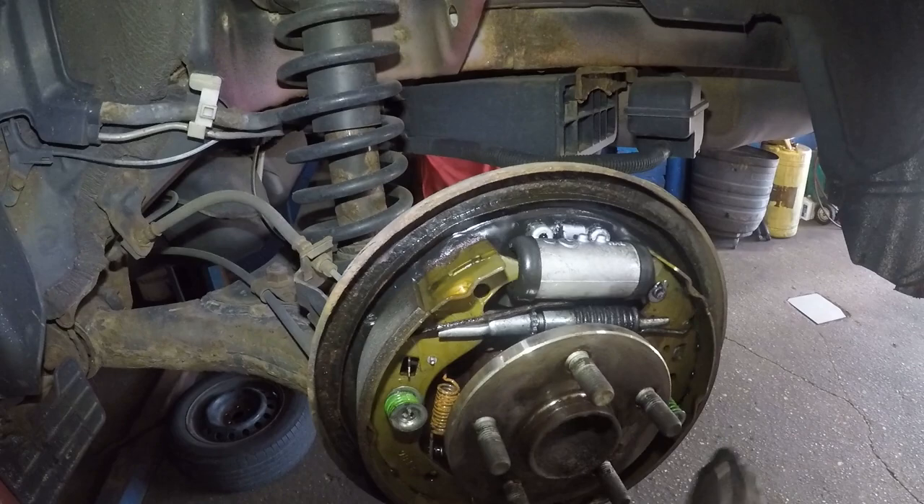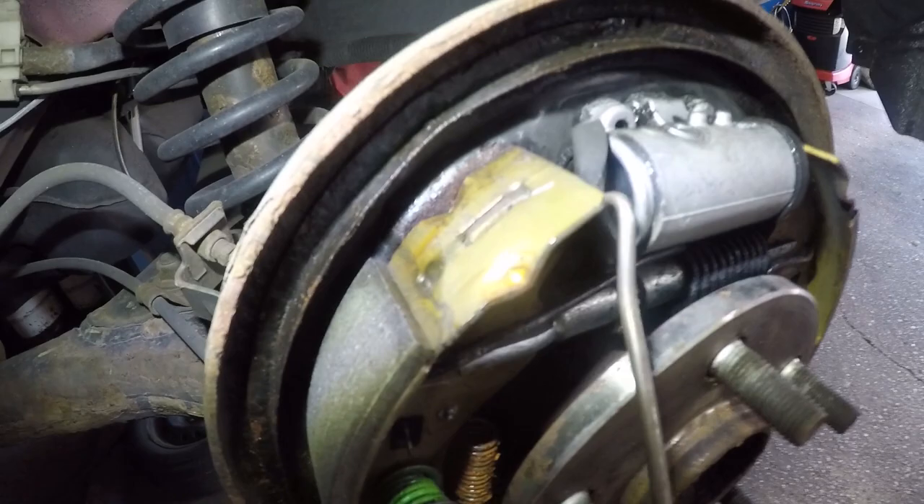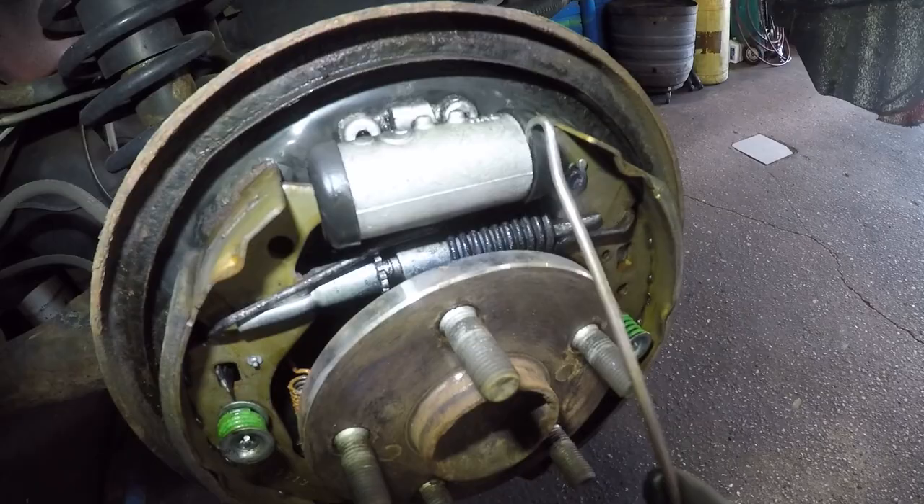All this is gonna vapor really quick — it's gonna dry up as we speak, it's drying up. What you want to do is get something to lift this up and look at a few things. If this drum seal is leaking, it's not good. Lift this up — no fluid, good, put it right back in. If you see fluid in there, bad idea to keep going — you might want to just service a new drum.